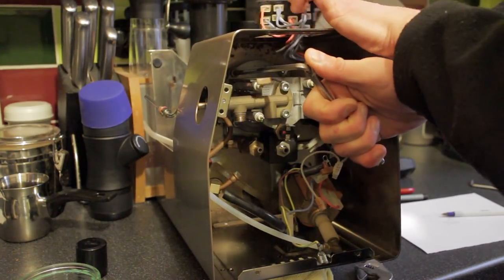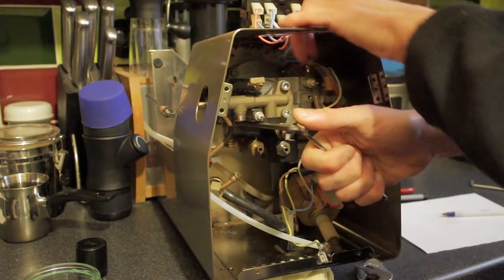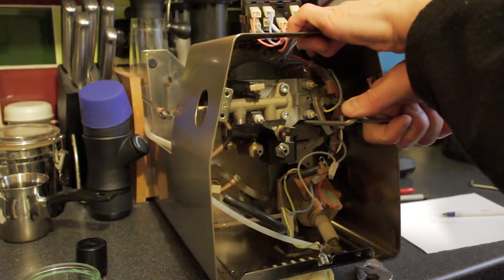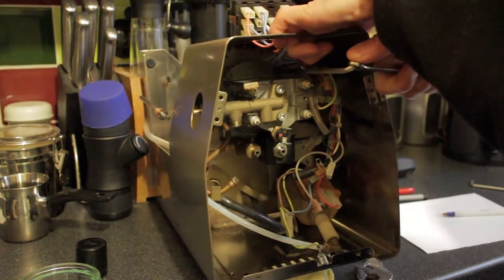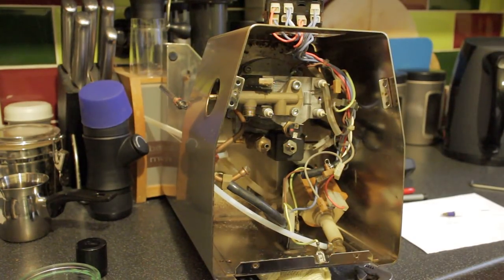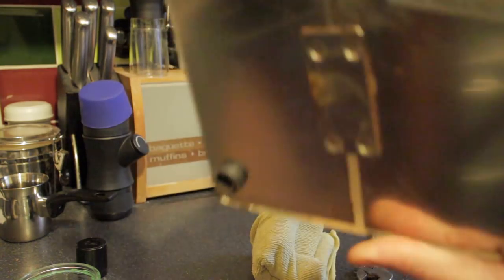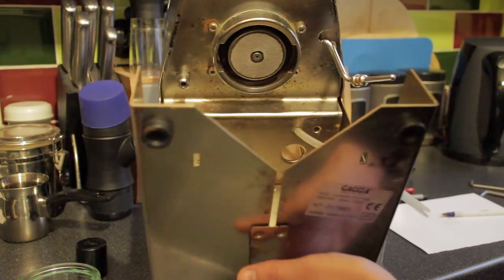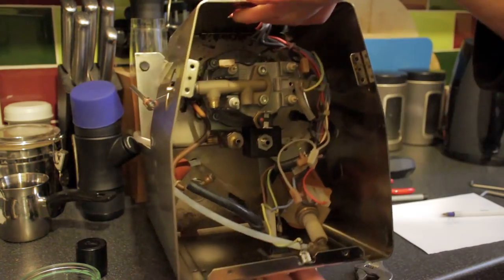The odds are these bolts will be a little stiff because they won't have been opened in years. You can hear them cracking open - it's not impossible, just easier if you crack them open first like so. Once you've done that, spin the machine around - you can see four four-millimetre allen bolts there. Undo these and the entire boiler and group head assembly will lift out.